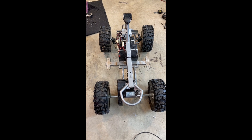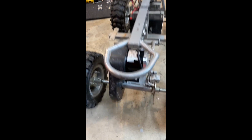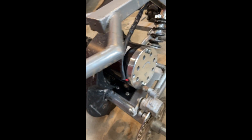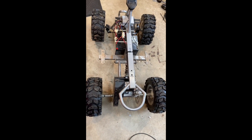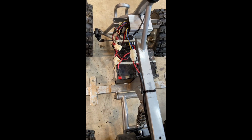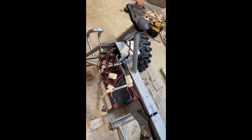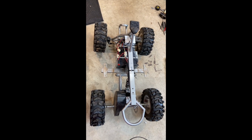Here's the finished product. The chassis is complete, the motor is in the new bracket I made, all tightened down with the chain guard modifications installed. I rotated the tires, and up front there are three 12 volt, 12 amp hour batteries totaling 36 volts in the tray I made, along with the 36 volt controller. Time to install the body and give it a rip.